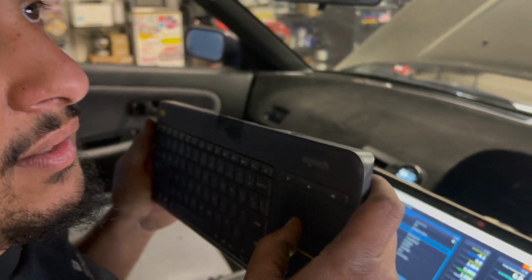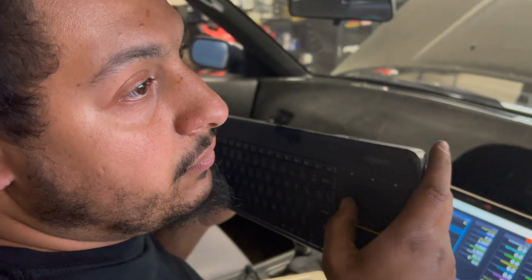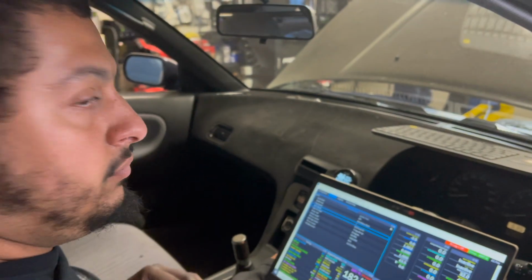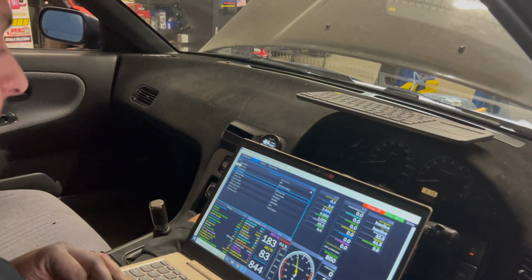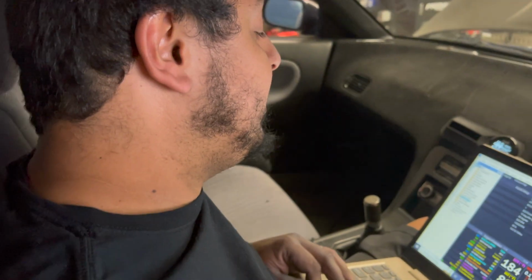It's popped off, but we got her fixed. Well, or we will. What are you revving up to? 75? 72. How many pounds is that? Almost like 19. It falls off right here. Yeah, it's the wastegate opening up. Internal wastegate issues. Oh, okay. That's a lot smoother than Kenrick.